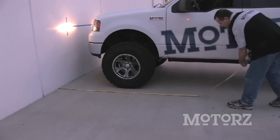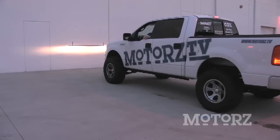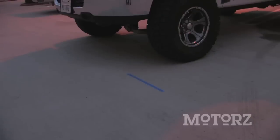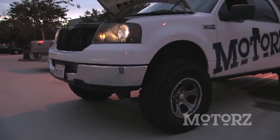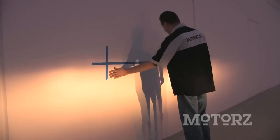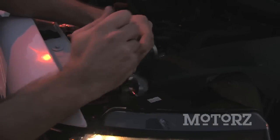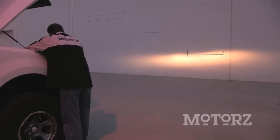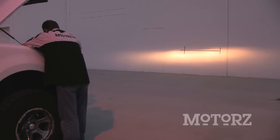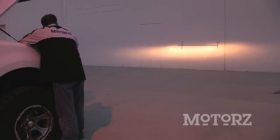Using your tape measure and masking tape, mark a spot on the ground exactly 25 feet away from the wall, then pull the vehicle straight back from the wall by that amount. Using the headlamp adjustment screws for horizontal and vertical alignment - on our F-150 we just have a single post - position the most intense part of the light two inches below the horizontal line and two inches to the right of the vertical lines. It's always best to aim lower and to the right so you don't offend oncoming traffic. Since this truck has a single headlamp lens for both low and high beams, once they're aimed, you're done.